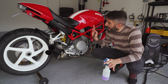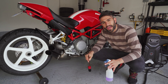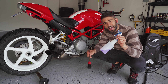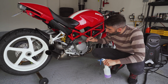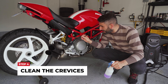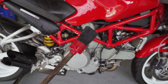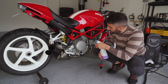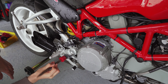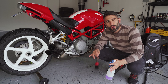The bike is now completely rinsed and a lot cleaner — the wheels are much cleaner — but we still haven't done any of the major paintwork yet. Before we begin that, we're going to use some all-purpose cleaner. I love Super Clean mixed with water at a half-half dilution in a spray bottle. We're going to go into all the nooks and crannies of the motorcycle. This isn't like a car — there's a lot of other things we need to address before we actually start washing it with a mitt. I love this little brush — very handy. I'm going to soak some of these areas with the all-purpose cleaner and dig into it. Once we clean out all the nooks and crannies, that's when we'll rinse everything and then use our wash mitt for the rest of the bike.